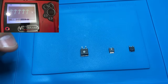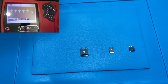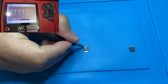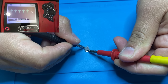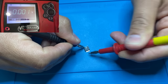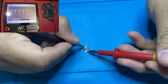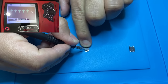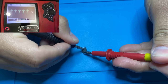There's definitely a difference between testing on the circuit board versus testing on the bench. Sometimes you can get away with testing it on the board, but to get accurate results, the best way is to remove the component and test it by itself. Moving over to the smaller transistor — same test. Negative to source, positive to drain — no continuity. Touch the gate briefly, come back to the drain — we have continuity. Short the gate and drain together to discharge the capacitor — no longer have continuity. That transistor is also good. So all these components are good.